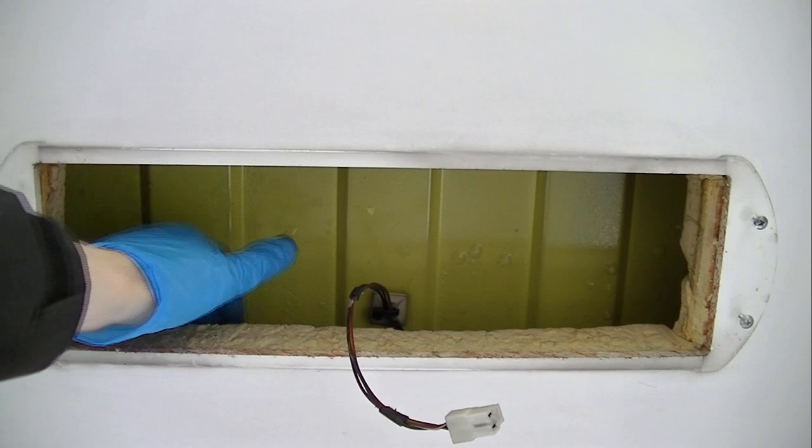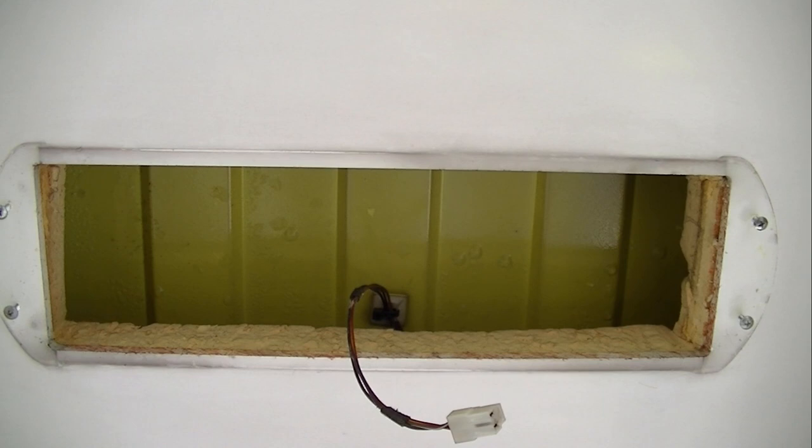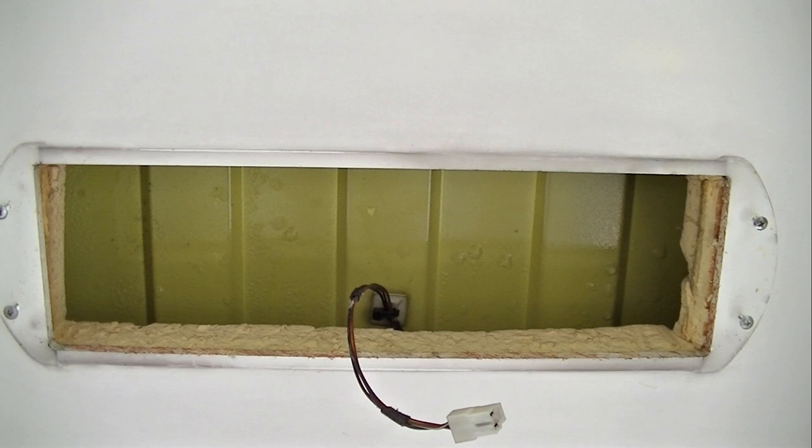Directly above that there's a gap of about three inches and you can see it's soaking wet. There's condensation all over the place up there and that's what was dripping down onto the foil back of this — if it is a foil back. You can actually see where the water's been running on the light. And that's just one example. I expect the entire van's like that all the way through.